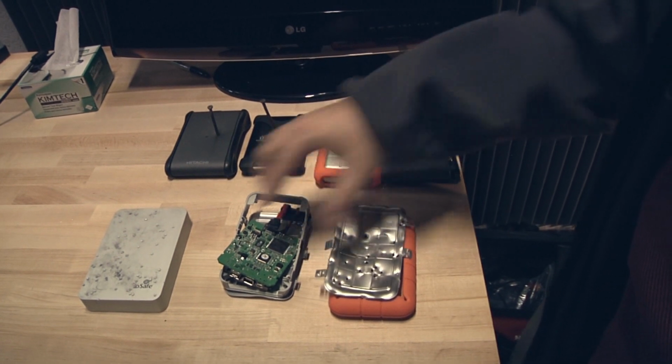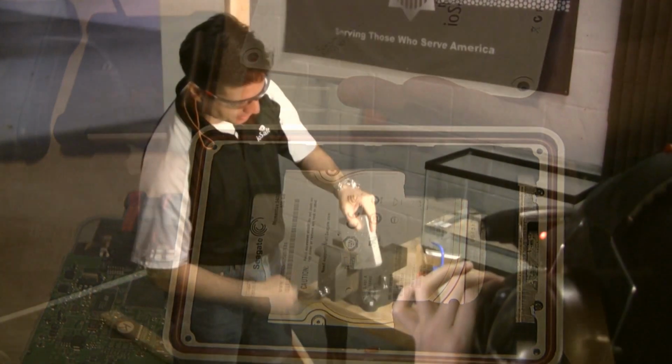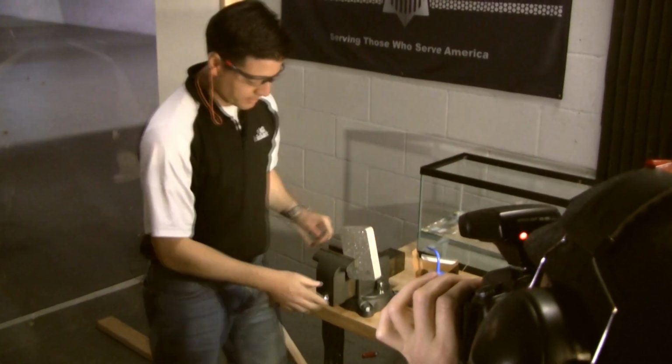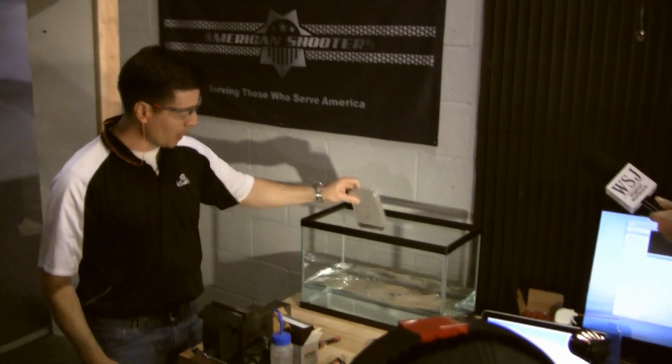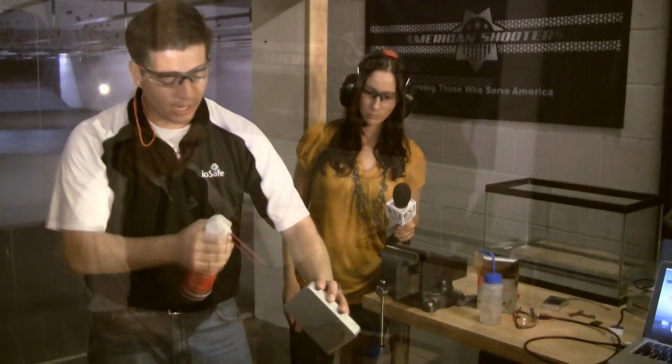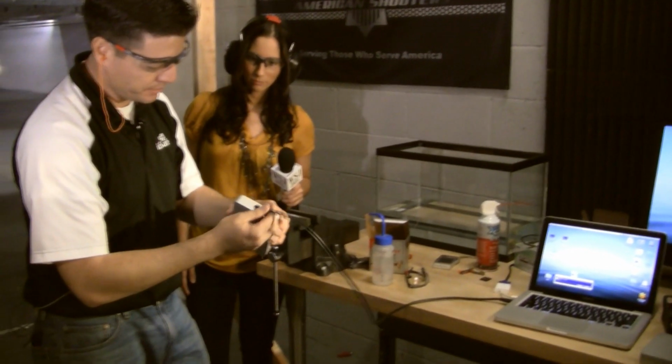While the performance of the Rugged Portable is average, it's the drive's disaster bona fides that make it a standout. The aluminum version of the drive can withstand crush forces of up to 2,500 pounds, while the titanium version can withstand 5,000. The sealing system used by ioSafe is guaranteed to survive a salt or freshwater bath up to 30 feet deep for 72 hours, while also protecting against full immersion in diesel, oil, hydraulic fluid, or other caustic chemicals.